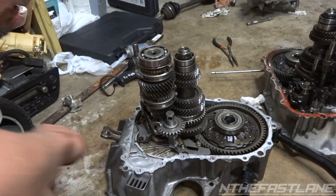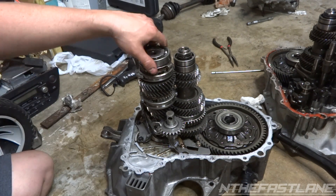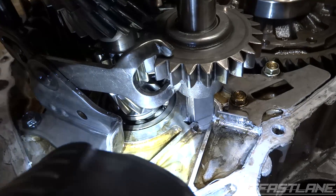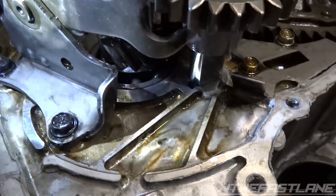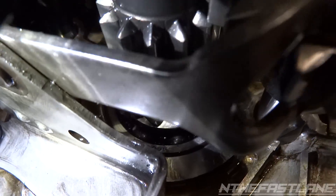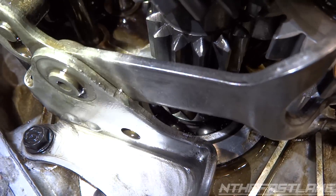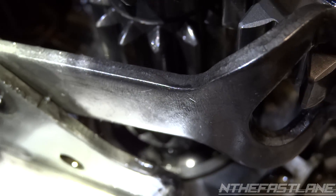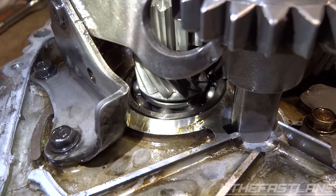You can check your ball bearings in there - I'll give you a quick shot so you can see how to identify a bad one. You'll be missing ball bearings, or they'll be shaved down, or it'll just sound really rough. Here's the bearing - as you can see going down the main shaft, all my bearings are intact with a space between them which is completely normal. Move it around and look at the other side to check if they're all good.